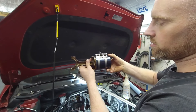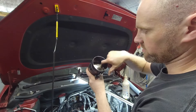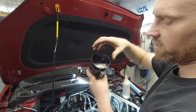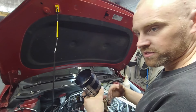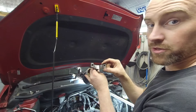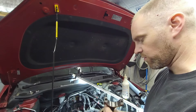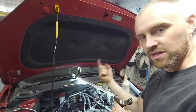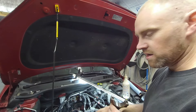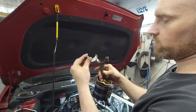You can see I have a ring compressor on here. If you look closely, you'll be able to tell that it is very crooked — I did that on purpose. There's a gap over here and it's against the piston on the other side, as tight as it can go. I did that on purpose to show you something during the install. But first, I'm going to put the bearing in. Typically it's best to leave the bearing out so you don't drop it, but these pistons slide in so nice and easy that I'm not worried about the bearing flying out.